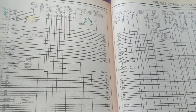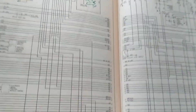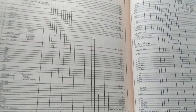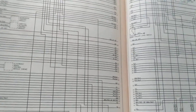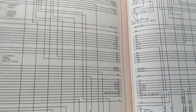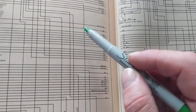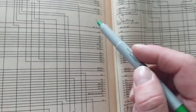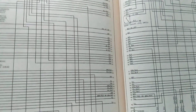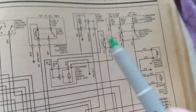If you're learning from this, please visit my channel — Joel Electronic Schematics for Auto. I made a video on the dashboard voltage gauge: when you start the car in the morning, the battery should show 12 volts; once running, it should show 14 volts, meaning the charging system is working. That's one quick way to assess the battery and charging system without a multimeter.